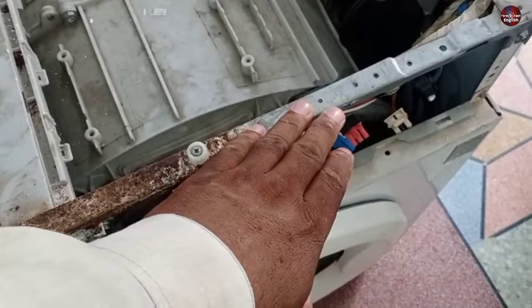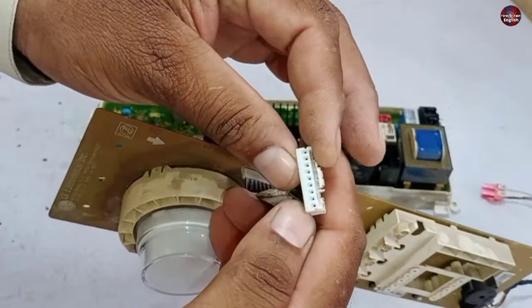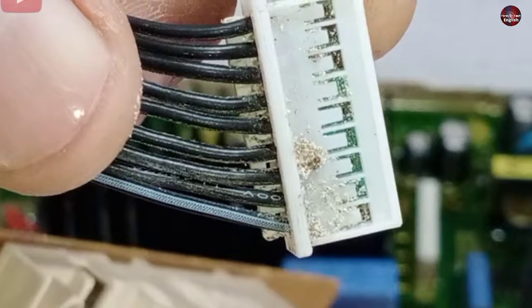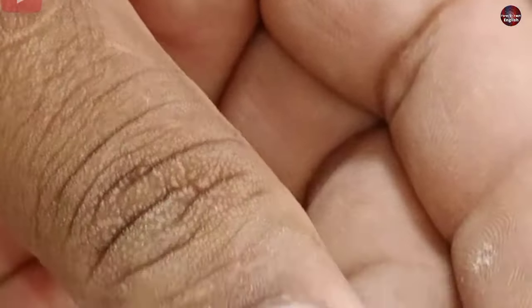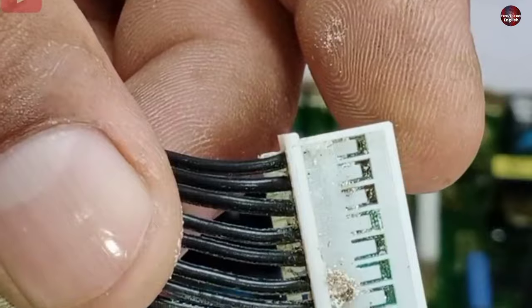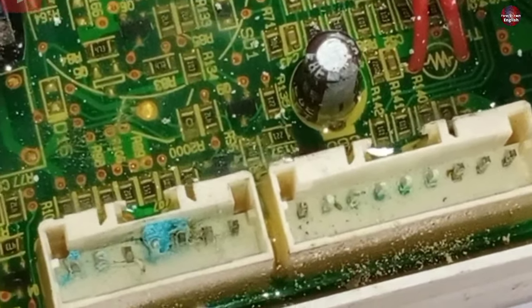The other side of the washer is fine, which is a clear indication that water has dripped on the wires. See the connector condition due to water — scales have been made inside the connector. These scales create conductivity on the connectors, and the motherboard will hang, meaning it will sometimes start functioning and sometimes not.